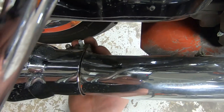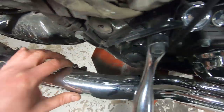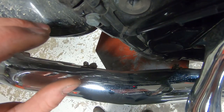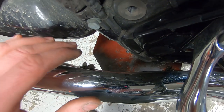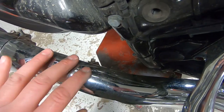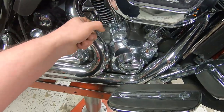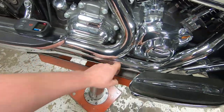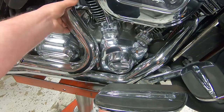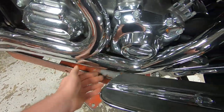While we're here we should take a look at the exhaust system and make sure the exhaust clamps are in good shape. The worm drive clamps can sometimes rust or break, and they can spin around and rattle and damage the finish of the pipe. I tap it with my finger and you can feel and hear if it's loose. You want to make sure they're all nice and tight and none of them are broken.